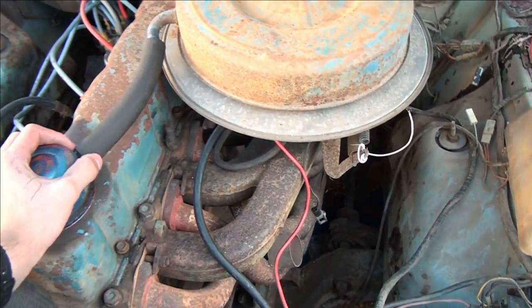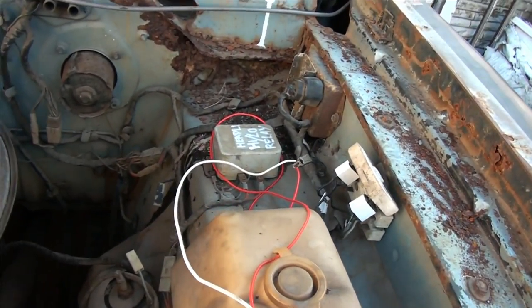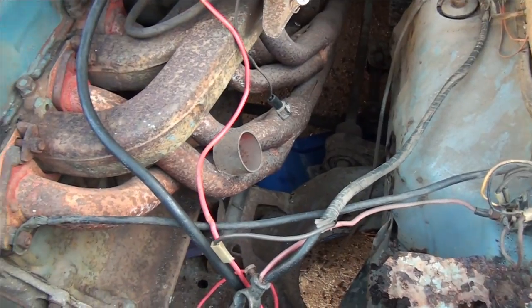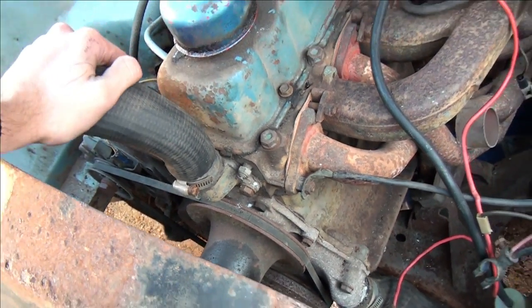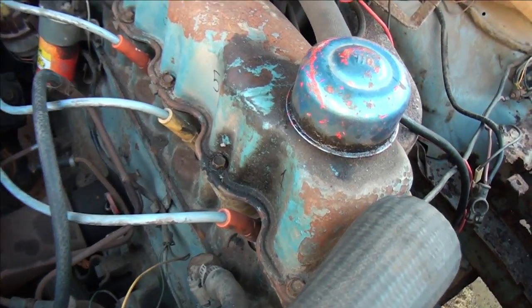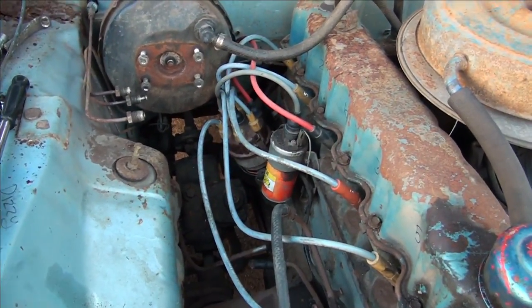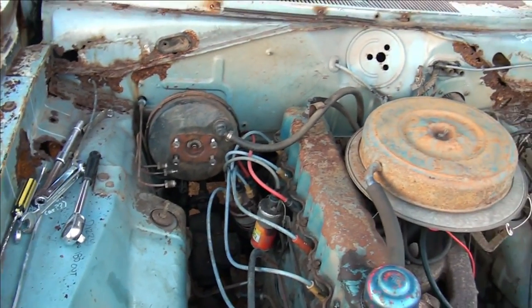It has some little modifications which are very odd. They were running without windscreen wipers - this was all horrible. I've got two ballast resistors in here at the moment. I'm waiting on my voltage regulator because that's all I'm missing. It powers on, it runs, and this isn't actually too bad after I flushed it. The block's pretty clean. I just need to replace that thermostat. It's still got the body number and the VIN tag matches, so I can get it re-registered hopefully afterwards.